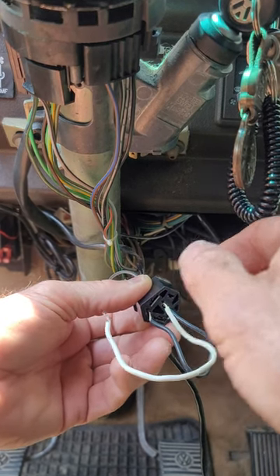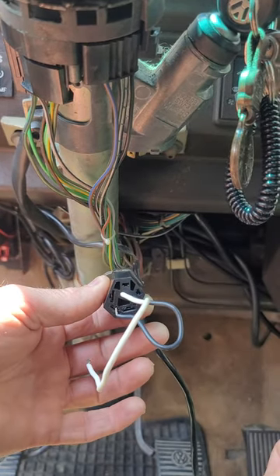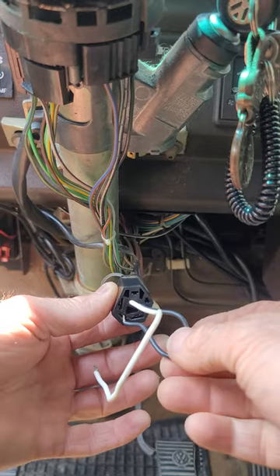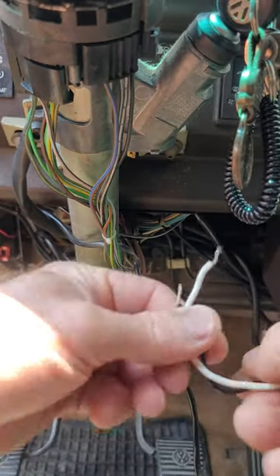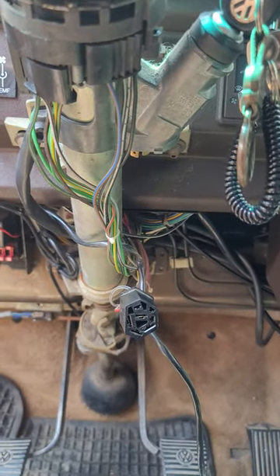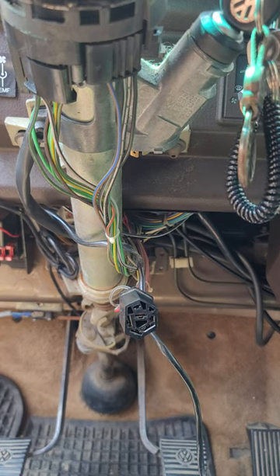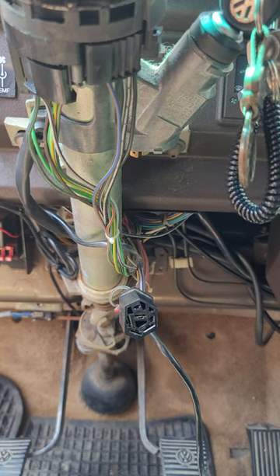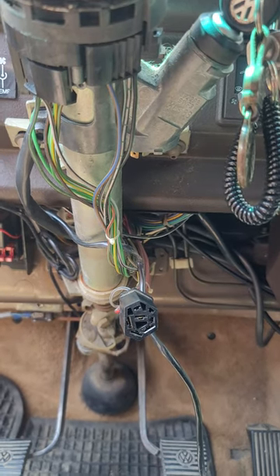Once it's running, just make sure you disconnect the starter. Keep the ignition wires together until you get to where you're going, then disconnect. You'll need to replace that ignition switch. I'll put a tag to the guy I learned that from, and also to the rebuild of that ignition switch which I'm about to do. But the hotwire is beautiful — isn't that the best?